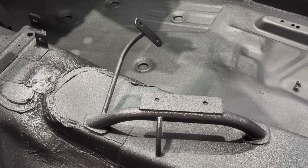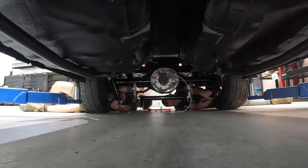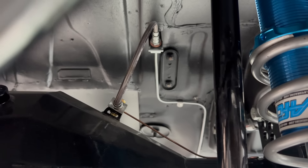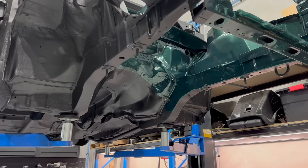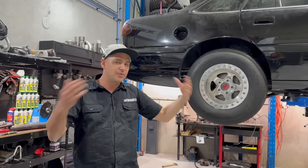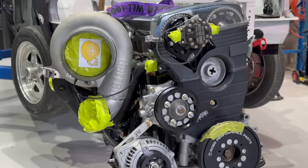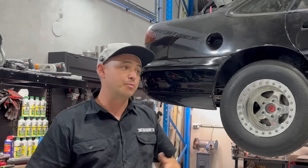The whole car is sealed up and we're ready to refit everything. I've already refitted the diff and all the control arms, and also refitted the brake lines secured with Raceworks stainless steel P-clips. I still need to make up a brake line hard line on the diff because I forgot while it was out. Pretty well everything was originally just dummy fitted, so nothing was actually 100% bolted on for good - the exhaust manifold, the inlet manifold, everything was kind of held on with just one bolt.